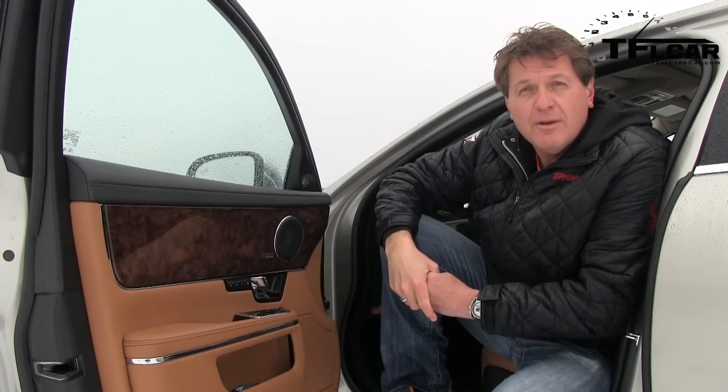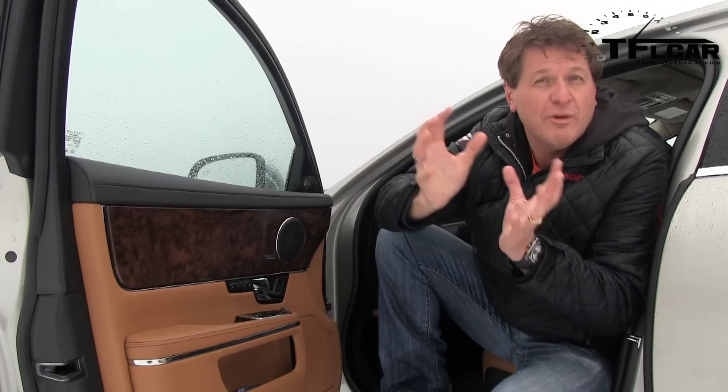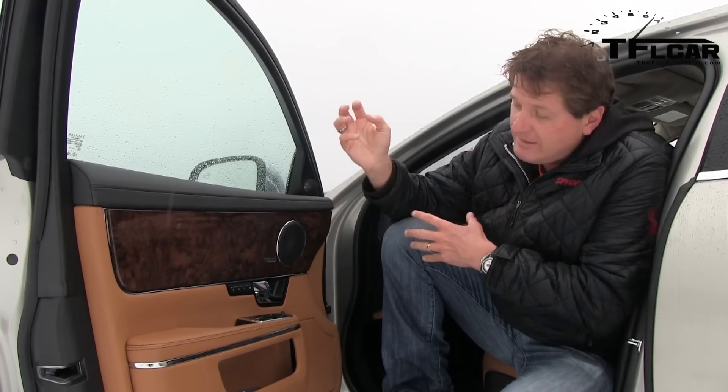You may be asking yourself how the Jaguar all-wheel drive system compares to other premium brands like the Audi Quattro or the BMW XDrive. The Jaguar system sends most of the power to the rear wheels, making it feel like a rear-wheel drive car, unlike an Audi which splits the torque 60% rear, 40% front.